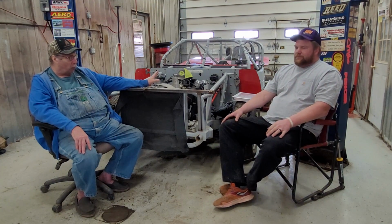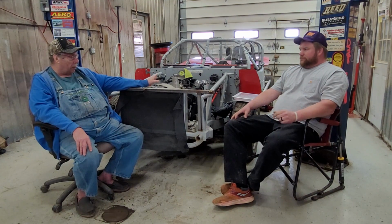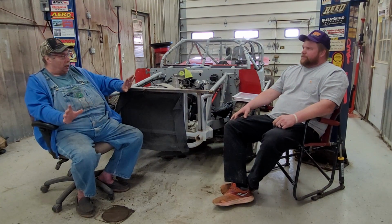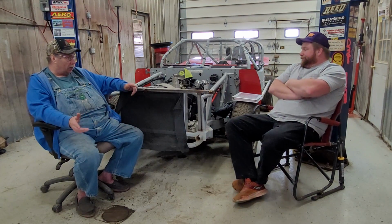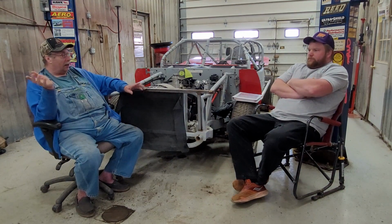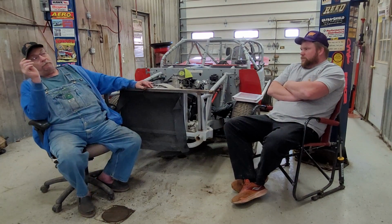I want to keep it where we're doing very minor distributor changes or very minor carburation changes, because you wouldn't believe how much of a change it is, just a few degrees or a jet change. You can fatten up a couple, 2 or 3 numbers, and you can pull off 15 horsepower just like that with a motor. I mean, it's safe and more. You don't lean them out, that'd be bad. We dealt with that last year.